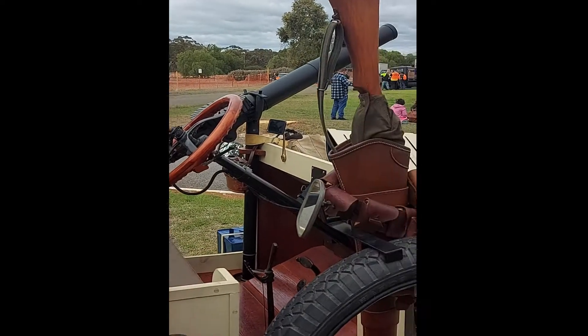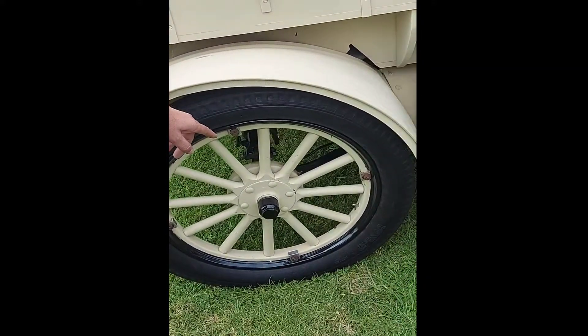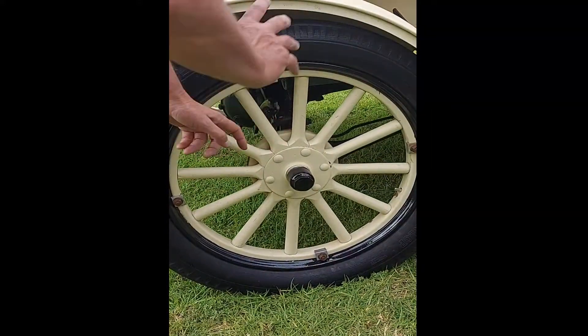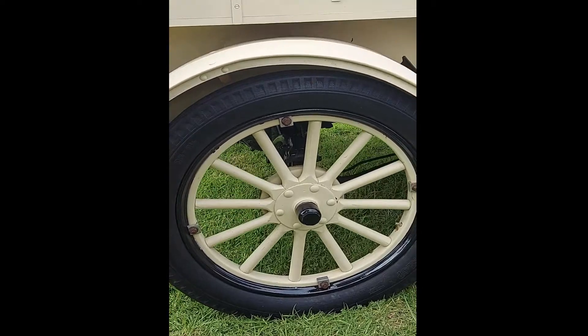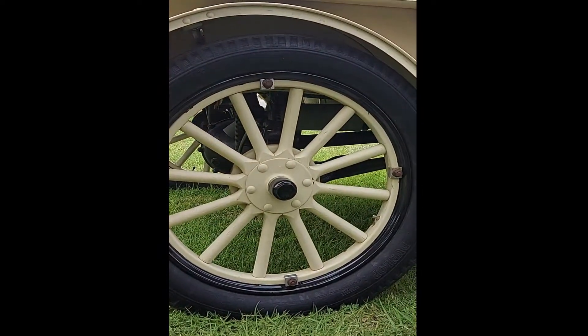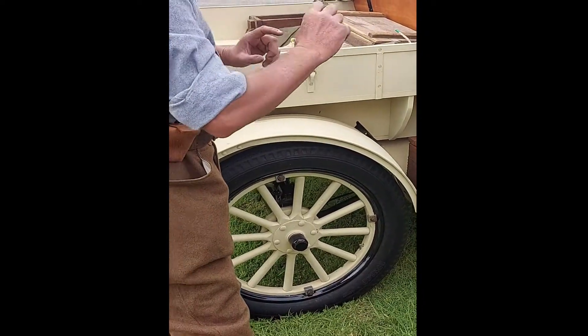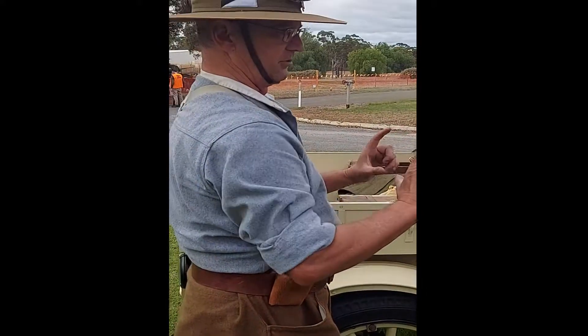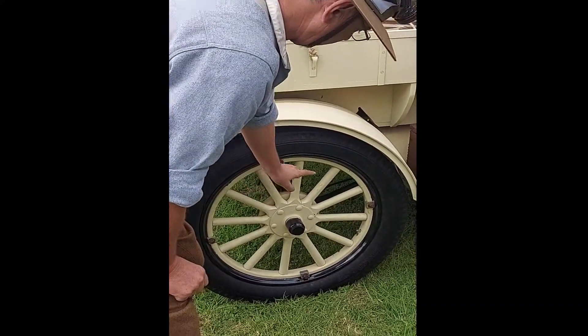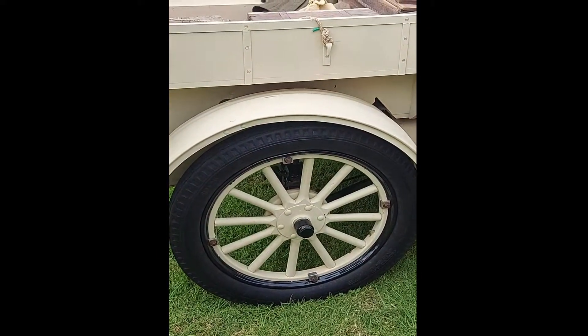So with the handbrake — where does it apply from? That looks like there's a drum in there. That is metal — that is your outer drum. There is a pair of shoes in there. It goes off of that rod, that goes up there, and there's one that goes into a cross rod to your handbrake. So when you pull that on, all it does is a cam in there that opens the pair of them up. So there's shoes inside there — and that's all it is. That's a full mechanical brake.